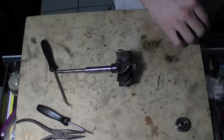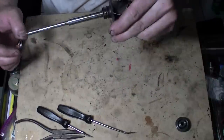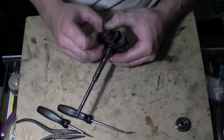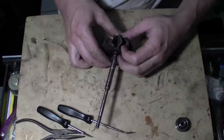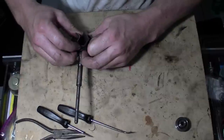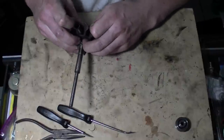Now that you have that all cleaned up really well, grab your piston ring - there's a new one. Go ahead and slide it over the shaft. You're going to work it onto that one, then slide your finger and kind of angle it, push it over to the other side and hold it, and kind of work your way around. This is not easy - be careful not to break it. You don't want to lift up, you kind of want to just slide it over. Hold it there and work it little by little, just like a piston ring, in small increments at a time, and eventually it'll slide right over.